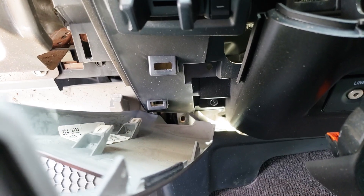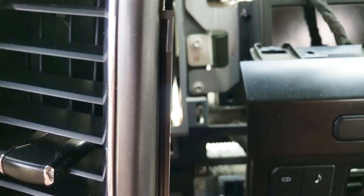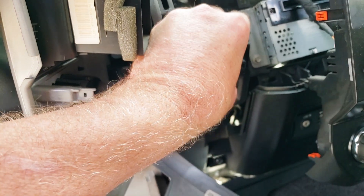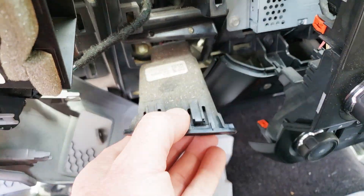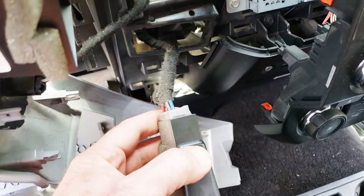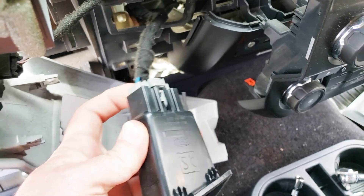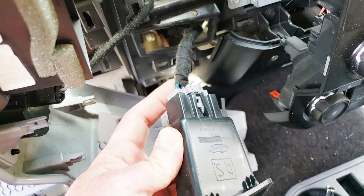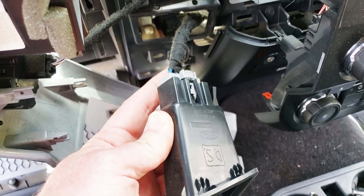The clips that hold the lower part kind of come upward, so when you pop the upper part out you've got to pull upward to get those clips out from behind there. This blank section here is where the brake controller is going to go. There are a couple of clips you've got to pop loose and then it comes straight out. It's wired — mostly just to hold the wires that'll be used for the brake controller — so we just have to take those wires off and put the brake controller on.